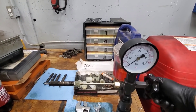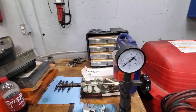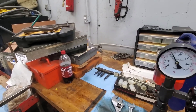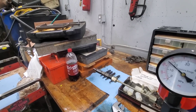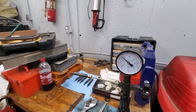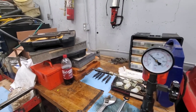We're going to go with the fifth one now — about 3,500 again, pretty decent looking spray pattern too. This is injector number 6. That one was closer to 4,000, but definitely over the 3,500 and below 4. The spray pattern doesn't look bad either.